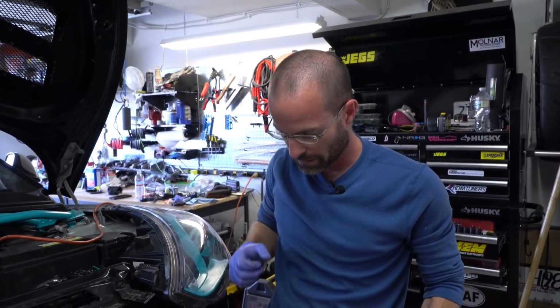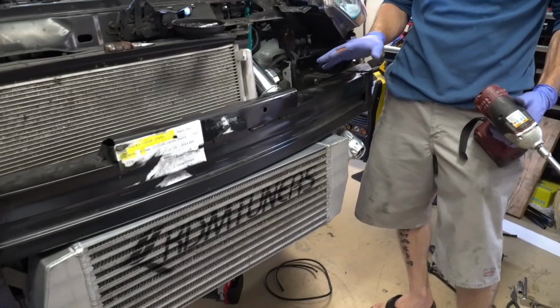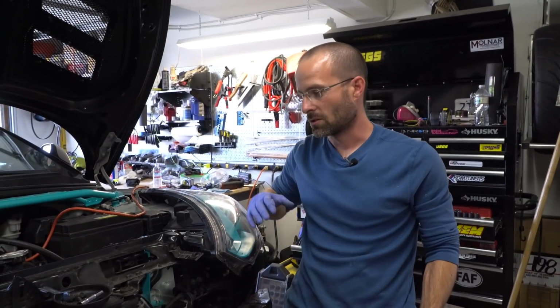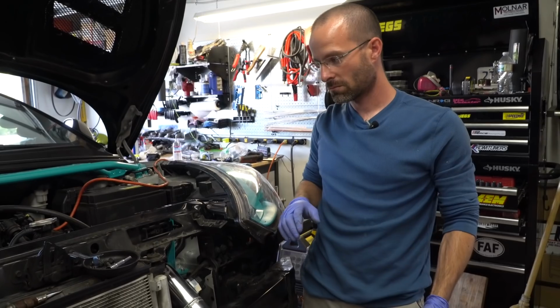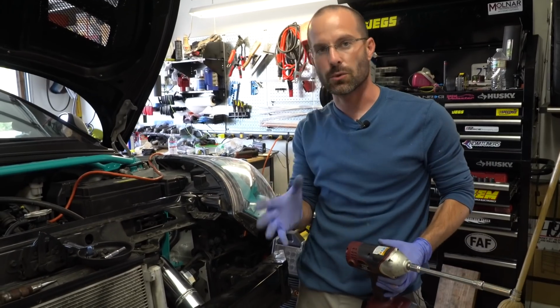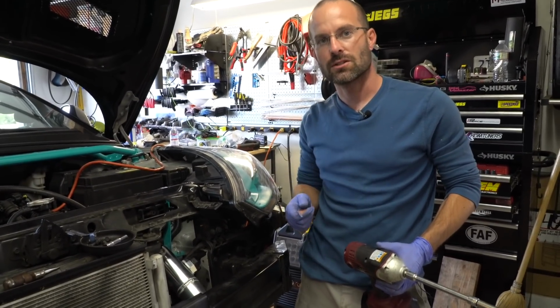So we got the cold pipe side of it all pre-assembled. We left everything loose on this side. At this point, it's not moving. This is where it's going to live. So go ahead and button up the whole cold side. We're going to tighten every hose clamp. I use a Makita, or the Matco, just to get all the clamps tight quick, just to save time. I'll go over each one with the wrench just to make sure they're tight.